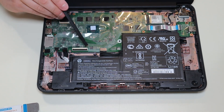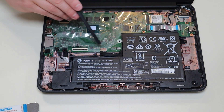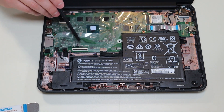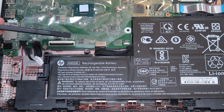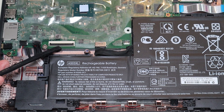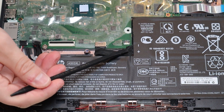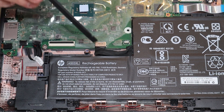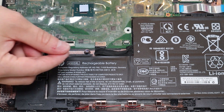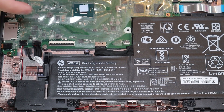This is the large connector for the keyboard ribbon cable and this is the smaller one for the touchpad ribbon cable. They both work the same way — this clip is black, this clip is white, and they're very fragile. Take a small flat plastic pry tool and gently slide it underneath that clip and pop it up. Same thing with the white one — gently underneath, pop that clip up, and then the ribbon cables can disconnect. To plug them back in, get them in there nice and flush, make sure they're straight, and slide that clip down to secure the ribbon cables.